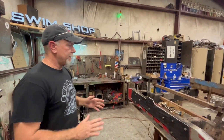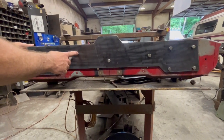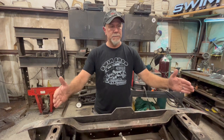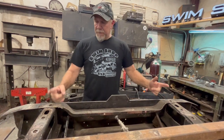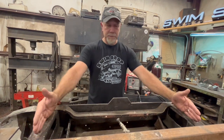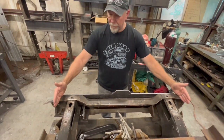I'm going to show you the reason why we can't do it right now, though we're still going to try. We've already got a plate cut — this is one of our plates. We're in the middle of making a kit. This is the plate we bolt to the front to start making the spring hangers and all that. This is an '87 frame, and from '84 to '95 — and some '96s — they're just like this. The spacing on these vans, center to center, is about 31 and a half inches. On the older vans, these frame horn rails are unitized or unibody, but these frame horns are out at 37 inches.